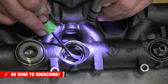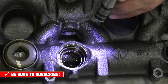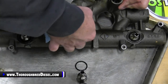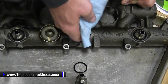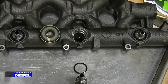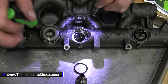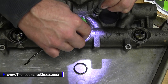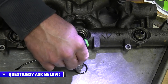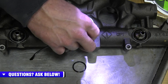The O-ring is right here and it sits on this ledge. I'll remove one of these old O-rings. I just want to clean this ledge up to show you the ledge, because we're going to go through and clean everything out. Here is the ledge that the O-ring rides on. The O-ring rides on that, and then the ball tube makes a seal inside of that because it is a chamfered ball tube. So it's going to engage the O-ring, and then the ring is going to push everything together and create your seal.